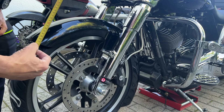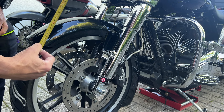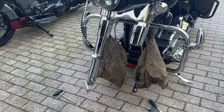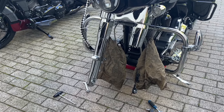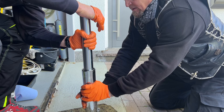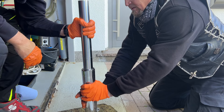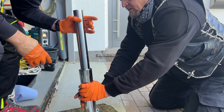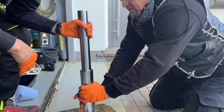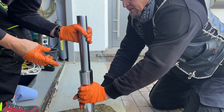We started to disassemble the fork in order to change the oil and check everything — and then the trouble started. First fork leg is removed. We opened it, changed the oil, and tried to bleed it. It was very hard to pull up, different than normal, and almost no 'plop'. It went down on its own but pretty stiff. At this point I knew something was terribly wrong inside the fork — it was not just the wrong oil and the wrong oil level.